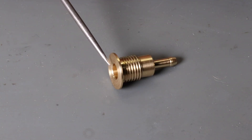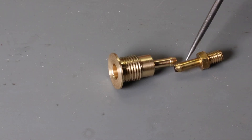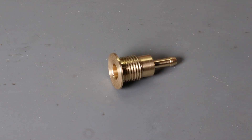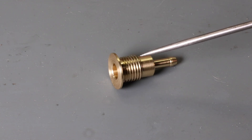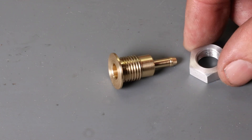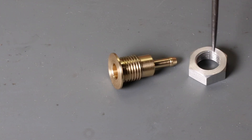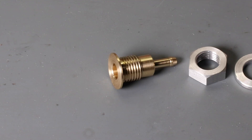The bore I reamed to 7mm to ensure a good fit on the pressure sensor O-ring — very nice smooth finish. The hose connection I made the same dimensions as the stock crankcase connector. I threaded it so from the other side of the tray I could use a nut — I used a fine pitch thread, M12 x 1.25, which is not a stock size, so I made this nut out of aluminium along with a washer to go with it. I'll assemble that now and see how it goes.